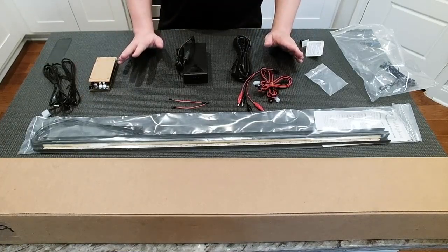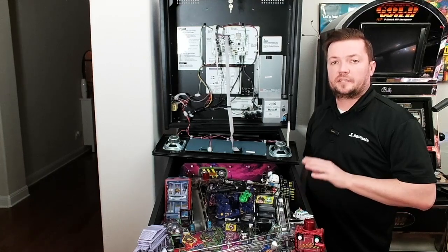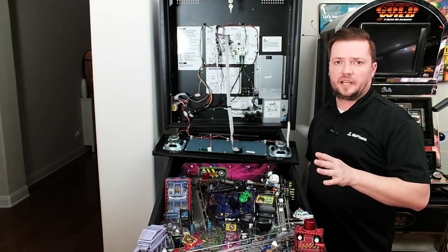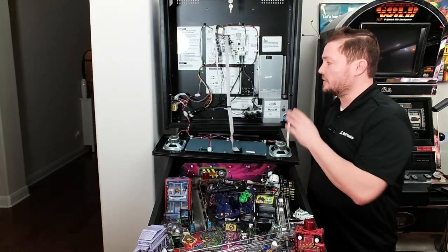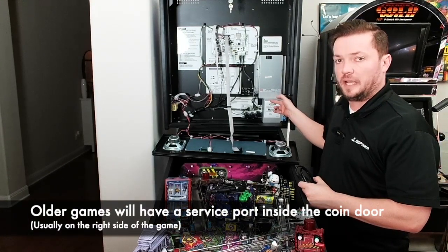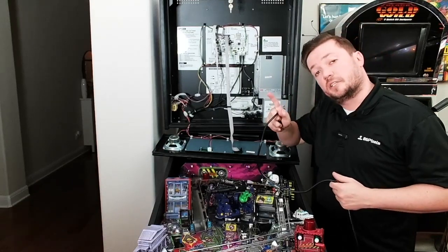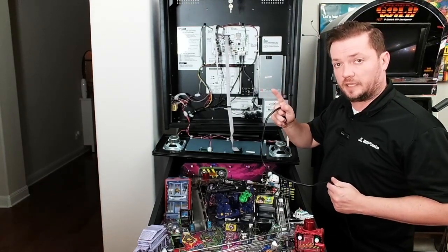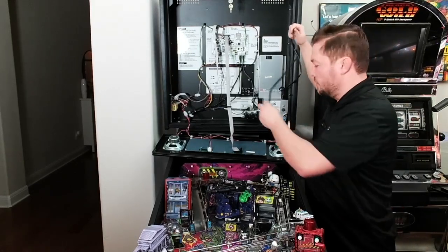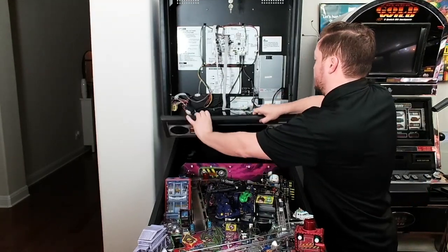That's the inventory and prep. Today we're installing Pin Lights on a Stern Ghostbusters Premium — don't worry if you're installing on a WPC Bally game or any other game, the process is really similar. Open up the back box and locate the service port. On Stern machines, they typically have a U.S. power adapter. Make sure your game is powered off and unplugged, then plug the power cable in and drop it down through one of the wire channels. We're pretty much done in the back box.